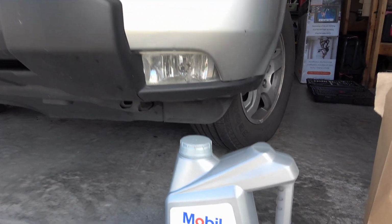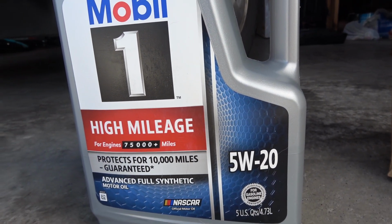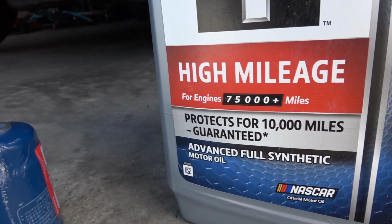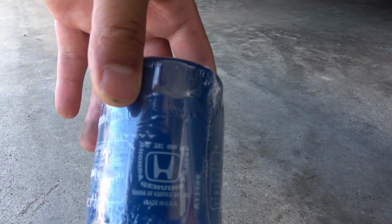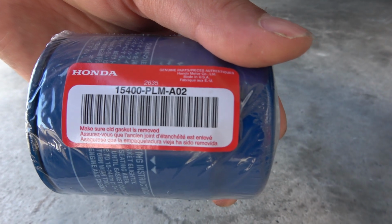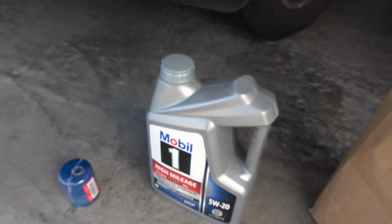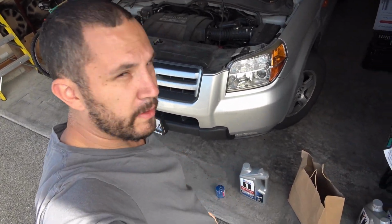And we're going to be using Mobil 1 full synthetic 5W20, so it's the proper oil weight. This is high mileage oil, so it has a little bit better additives in there to help condition the rubber seals on the engine to keep them from leaking long term. And then we're going to be installing an OEM Honda oil filter with a brand new crush washer to ensure that there's no leaking. This is the model number of the oil filter, and I will have a link in the description down below of where you can pick up the exact oil filter as well as the oil on Amazon.